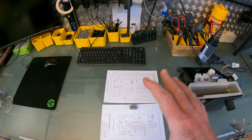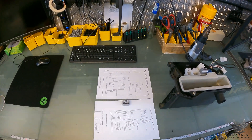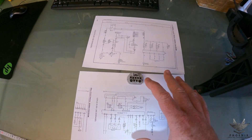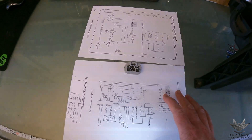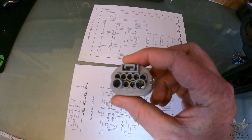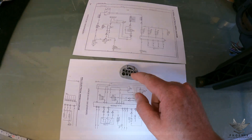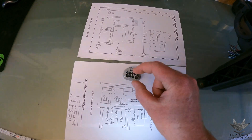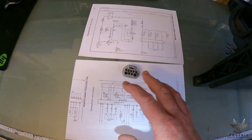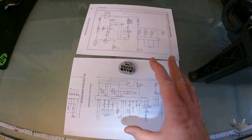The first thing is the reverse switch. Because you've put a manual in, you need to connect the reverse switch, and that is relatively straightforward. On your gearbox harness you've got four connectors — those will be unplugged now because the auto gearbox is gone. You're looking for the selector plug. You only need two wires: the 12 volts that comes into there and the wire that does the reverse. You're going to cut those two wires and join them to your reverse switch, in whatever format that takes. It's going to be different for every single gearbox.